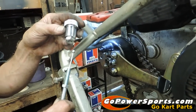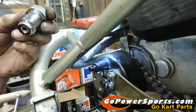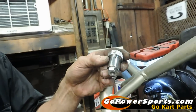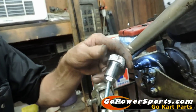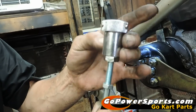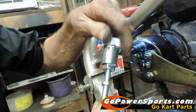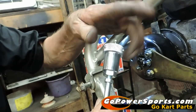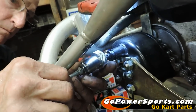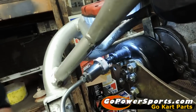When we were removing the cable, we were showing you how to put the clip back here and hold it in position. We did have to put a new reverse assembly on this unit, but they're the same style going back. We're going to screw our cap back on — that's your easiest adjustment for your cable, this cap right here. It's going to be your quickest and easiest instead of using your cable end adjustment. Now Scott's going to position that ball in the groove, in the socket of the reverse assembly, and then pull the snap ring back over the groove that keeps that ball in the socket.